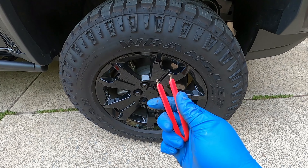After everything's in place, we're going to bolt everything back up. Right after installation, you're going to want to use the new strut nuts — these are 17-millimeter instead of 18-millimeter like the stock ones. They have a lower engagement on the thread, but there's more than enough engagement, and they are also a locking nut with a nylon part that will ensure these things never back off on their own. To get the control arm into the actual spindle, you've got to devise something like a pry bar — in my case a breaker bar wedged into the strut tower — and push down enough to give you room to get that 18-millimeter nut back in place. Then just tighten up all the bolts and you're good to put the wheel back on.